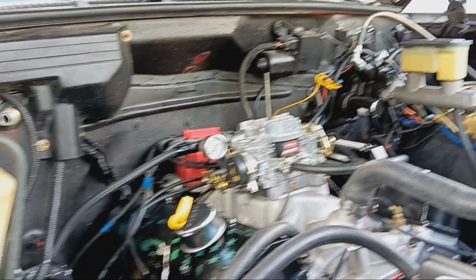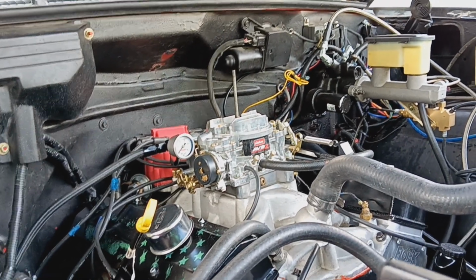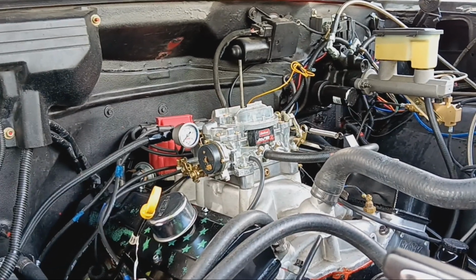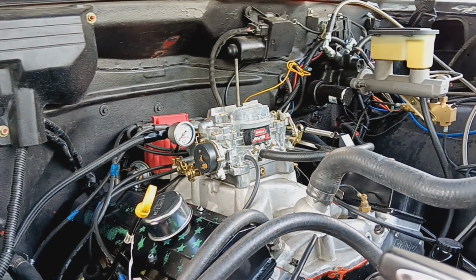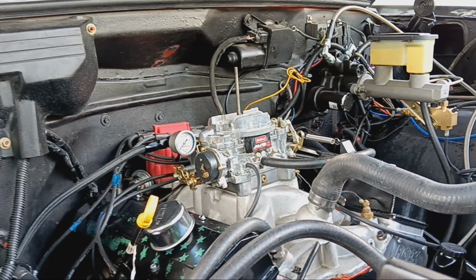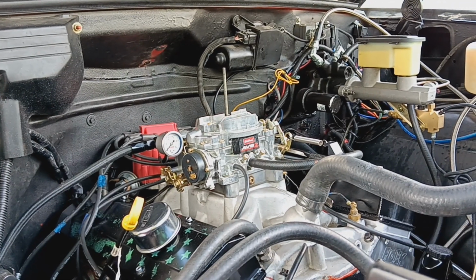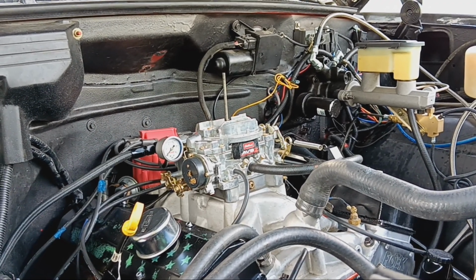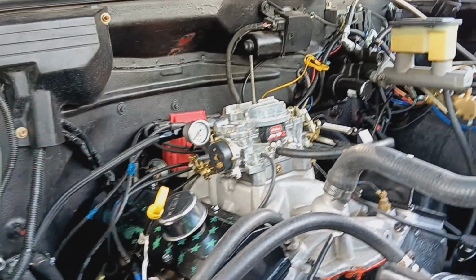Next time out in the garage, I'll get them out and show everybody. But yeah, it's all back together now. If you buy a set of those Howard's 91113 OE Performance roller lifters, just go ahead and take them to about 50 thousandths preload. We had to change push rods because at 53 thousandths, then you add another 14 to it, they were a little bit short after preload. The rocker wasn't setting quite where I wanted it in the center of the valve stem, so we just did a little math, put a longer push rod in it, and adjusted for it, and then it's all fine now.